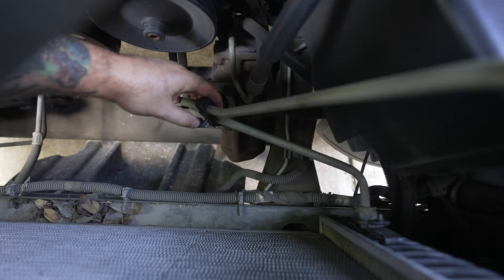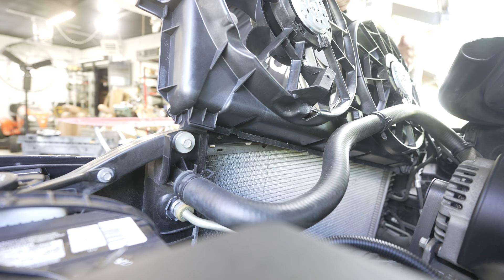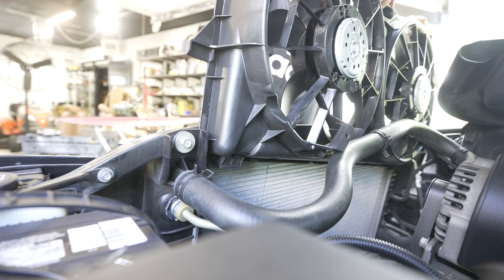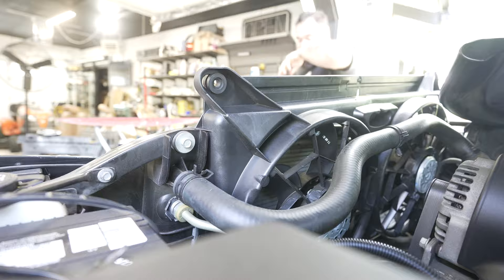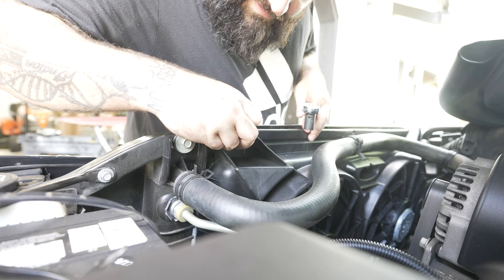I just got the bottom fan shroud out. There's one hole here and all that's in that hole is the clips for your cooler lines — you can leave that out. Now it is time to throw our new fan in. Fans are going in. I'm just going to move this hose and slip this down in there. See how it slips right in between — that's why you have to have the 34-inch radiator core. Just take your time, don't freak out, just work it around the tubes.